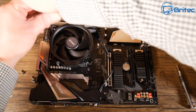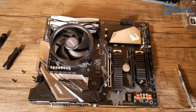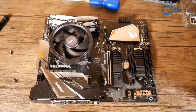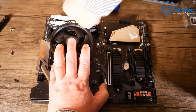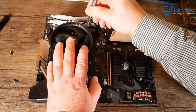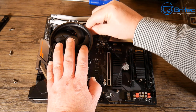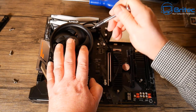The AMD bracket logo is around the wrong way, which is just how they do it. But it means we need to remove those screws and rotate it, because if someone wants to add two more sticks of memory it will stick out onto the memory slot. There are just four little screws to remove the fan and plastic shroud from the heat sink so we can reposition it — you can rotate it any direction you want.